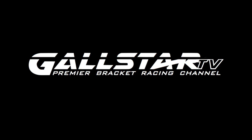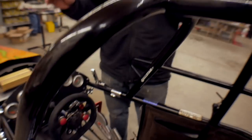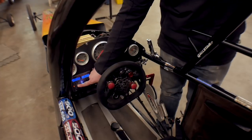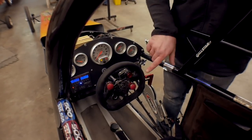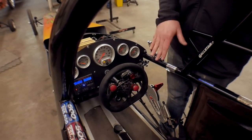The first question comes from Chad. He says he has been using his steering wheel trans brake button held down while steering the car in reverse — it's a bit clumsy while turning. If he sets the lockout to 20 seconds as I did, would he just have to hit the trans brake button once and it would be locked out so he could do all of his reversing? With Z-Force Plus, it's actually way easier than that. You can see on my delay box — if I go ahead and hit the trans brake button just once and let go, the trans brake is actually activated because of the push method. You have to click it to set it and then click it a second time to activate the trans brake.